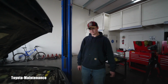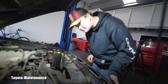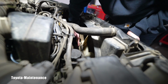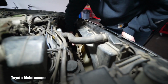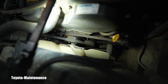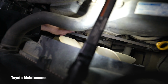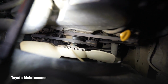Izaak will show us how he will check his cooling fan clutch. Let's see if he knows how to inspect and test his cooling fan clutch, which the fan is right there. So here's the clutch. If this is really bad, this will keep spinning if you pull it. But there's some resistance here, so it's all right. Well, very good. I love that knowledge. This is awesome. All three drive belts, which are down there, they seem to be in decent condition. There are no cracks. The tension seems to be pretty okay for now. So also these don't have to be replaced.